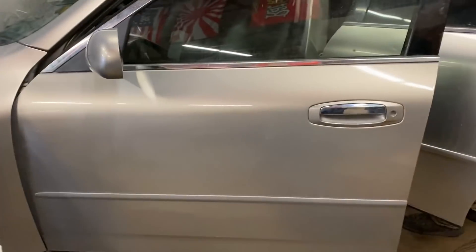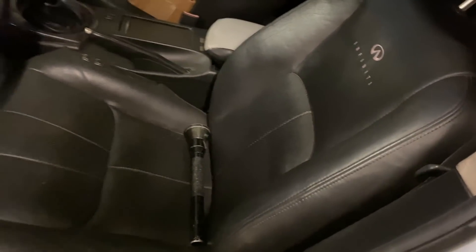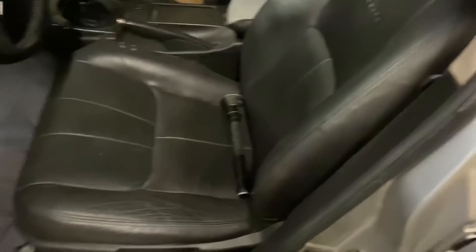Dented door — not dented door anymore. And the seat is in. It doesn't exactly match, but I think it still looks pretty good. We still have to figure out how to make it work. Apparently different model years had different plugs on the bottom of the seat, so even though this came out of a four-door G35 from the junkyard, the main power plug isn't the same. So as of right now it doesn't move, but it's already a huge improvement because it's not in the sleeping position. We're going to pull that back apart, get a wiring diagram, and put the old plug on there, so that should all work when we're done.